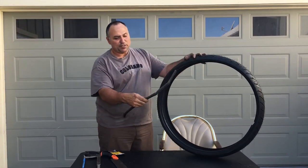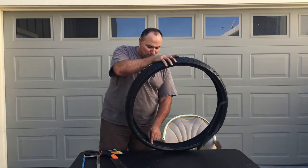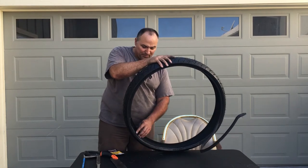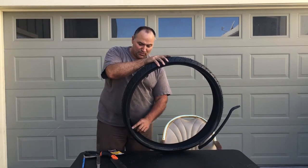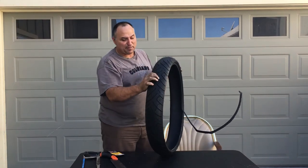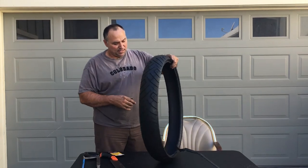After I cut off the bead I'll throw that in the garbage, and then I'll be left with this liner which I will scallop. I go to Harbor Freight Tools and buy the largest die grinder they have — the rubber is defeated easily by the die grinder. I'll use it to scallop the liner nice and smooth for my tube, and I'll put a couple of old extra tubes split down the middle so that anything sharp here isn't going to puncture my inflated tube and I don't get a flat from the inside. I'm also going to cut it so that when I inflate the tire it expands, and I think it's going to make a great tire liner.